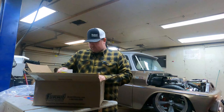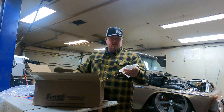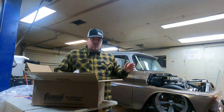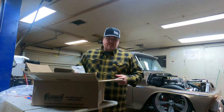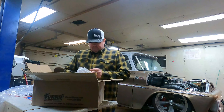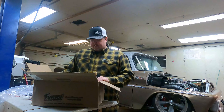May or may not be the right ones. I've got a bunch of brake line unions for the flared lines. They sell them in like a five-pack for about six bucks. I made all the lines for the truck. I really try to keep unions to a minimum, but when you're going up around a crossmember and trying to climb a firewall, it comes down to the unions. These seem a little heavier than the ones you pick up at Lowe's — the wall thickness seems better on them. I don't feel like I'm gonna round off the edges while I'm working on them.